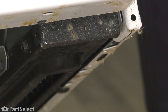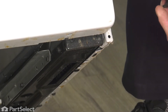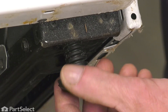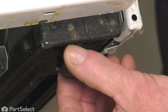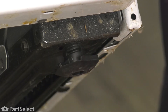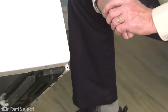Simply discard the old one, make sure the metal where the threads are is not damaged or distorted, and carefully line up the new leveling leg so that it turns in easily by hand. Position it approximately the same as the opposite one, then set the range down and do your final adjustments before pushing it back into the cabinets.